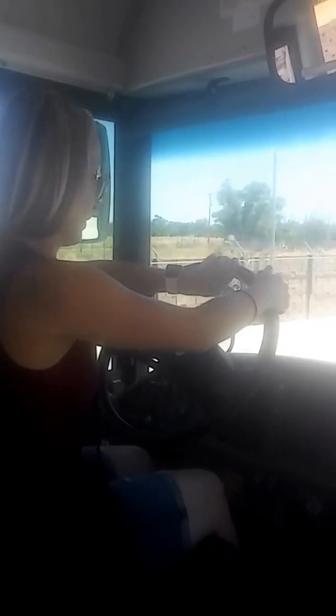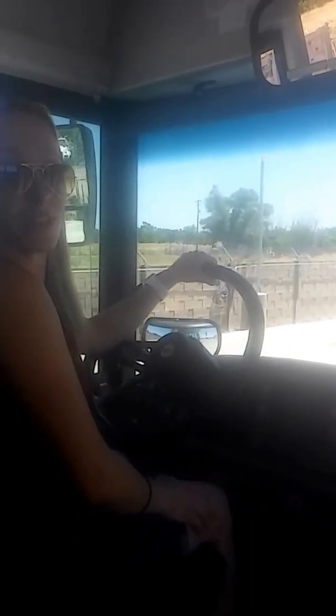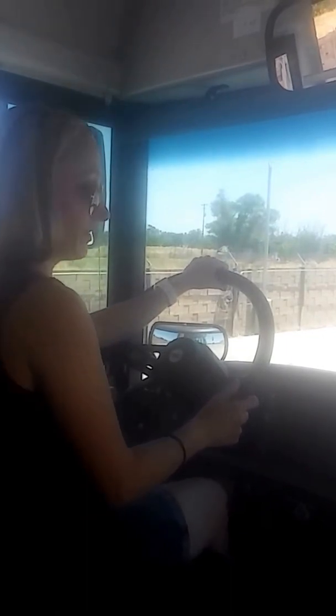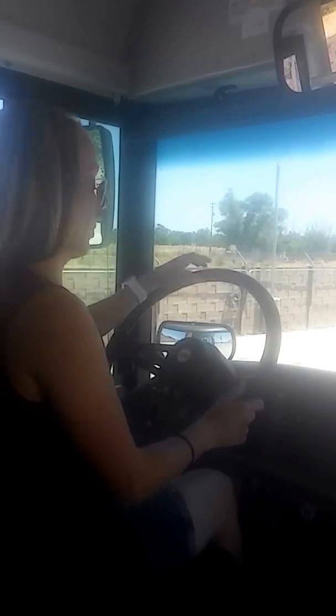Okay. And my time is up. Okay, didn't lose any air, so that was a good test. Now I'm going to go ahead and start my splitting of the tanks and checking for my low air warning and my double check valve to make sure they're working properly.